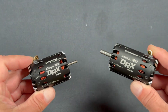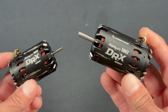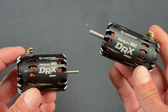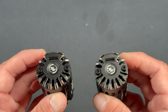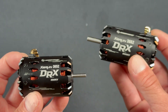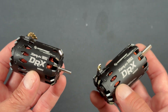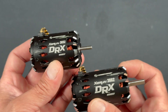Now, I know what you're asking — drag racing fans, you're like, where's the speed control? What speed controls do we use with this? XR-10 Pro G2S would be your best bet — it's got the most tuning. XR-8 would be the next choice, but the XR-8 series of speed controls — the turbo and the boost isn't going to work with these motors. Those have a lockout on turbo and boost that only works with scale motors. These aren't classified in that same category under the Hobbywing sensor ID system. So unless you're not going to use turbo and boost, the XR-10 Pro G2S would be the way to go. They're compatible with other speed controls that are sensored as well — they don't have to match. If you're going to use XR-8, they work totally fine, fully sensored — you're just not going to have the option to use turbo and boost. We are working on a drag specific speed control — it's been in the works for some time. We didn't want to rush that guy out, so still in the works. We're going to have a drag racing speed control in the future.